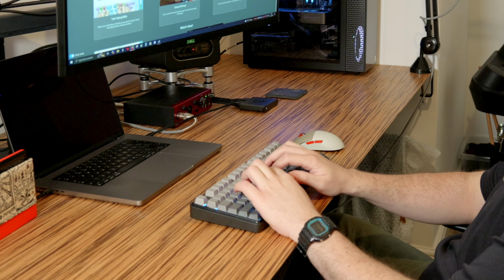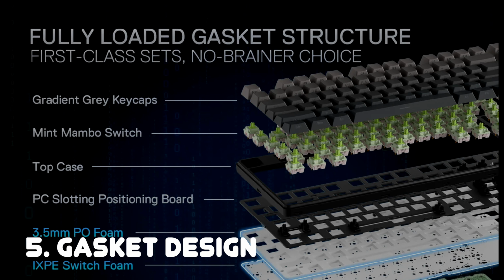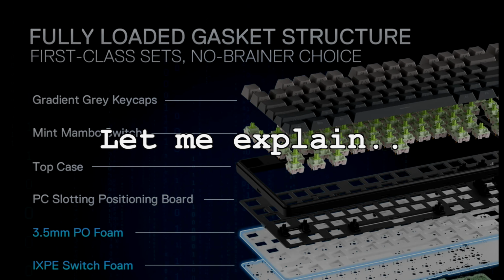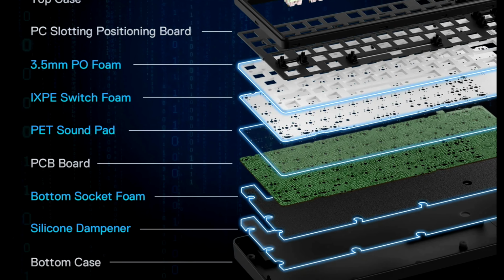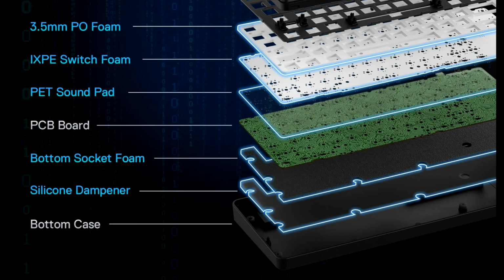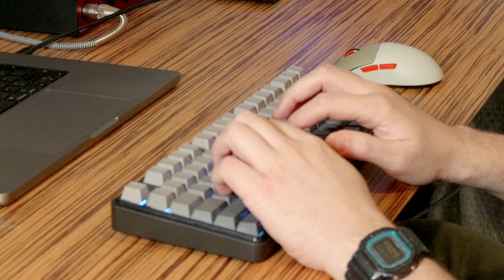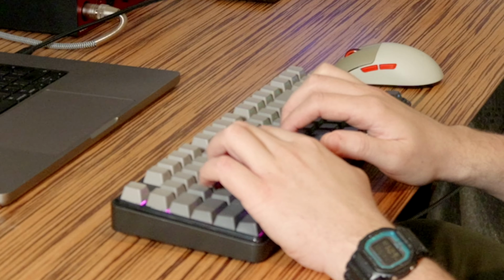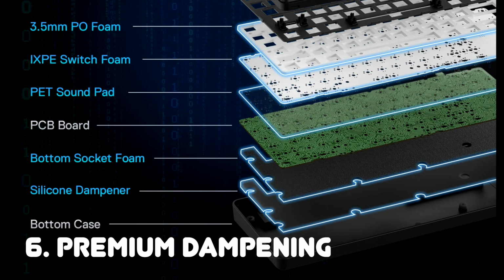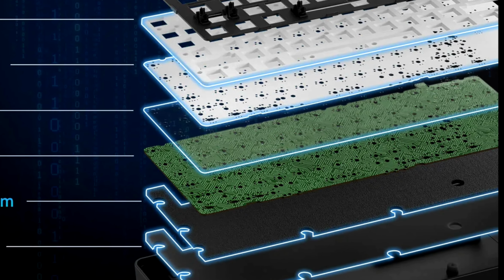I really like that, and that brings me to my next point, which is the specific build design of this keyboard. You see, lads, it's what's known as a gasket design. Let me explain. Gaskets create a softer, more cushiony feel by suspending the plate between the keyboard frame, so that reduces harsh impacts. This makes your typing quieter, isolates vibrations, and it's often associated with a higher build quality. And when you take into account that this keyboard is 50 quid, lads, this ain't a feature you'd really associate with a cheaper keyboard. And check out the noise dampening that you got inside it as well. This combines with the gasket design to make the acoustics and feedback you get from the keyboard more enjoyable.